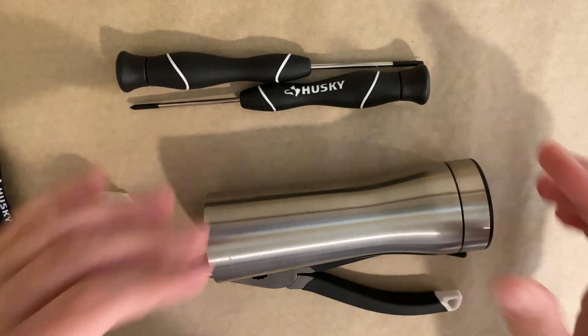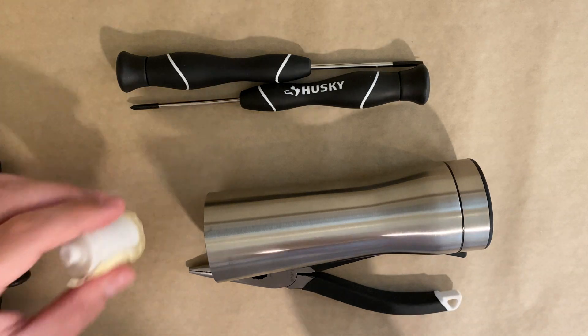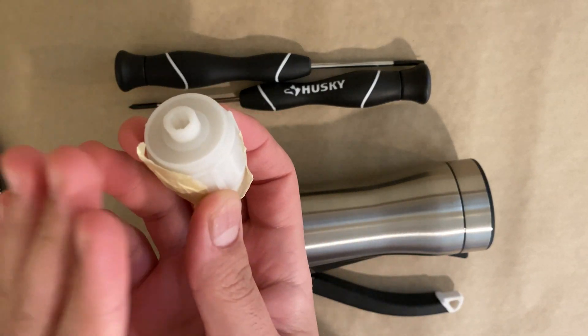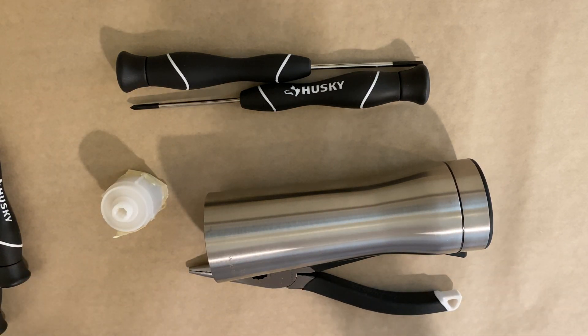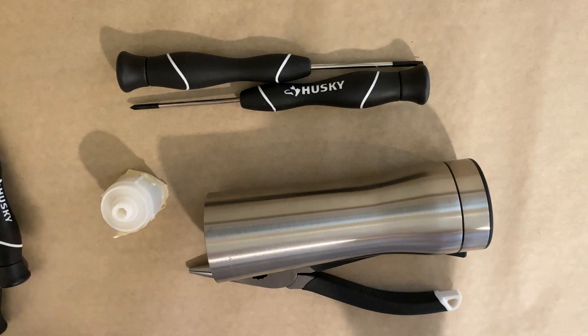Now this grinder has a DC motor but it also has a case just like this one with gears sandwiched on top of each other. What this does is it gives you more torque and more power. It doesn't give you more speed, but for something like a salt grinder that needs to grind the salt, it needs more power and torque.